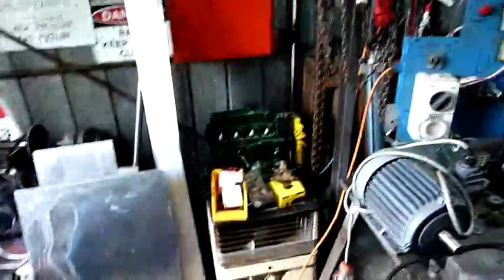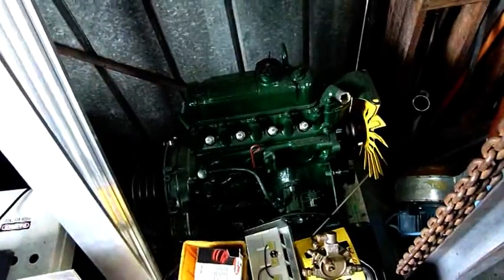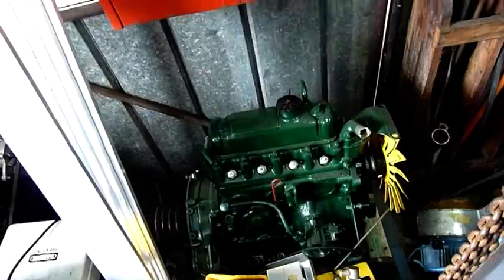The Morris engine is another thing. I looked up the Ryko part number that somebody gave me, and Ryko have discontinued them. So I'm probably going to have to buy a spin-on adapter or try and find something that's been sitting in storage for ages at some Morris specialist, as far as the oil filter is concerned.